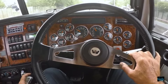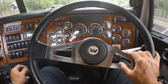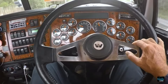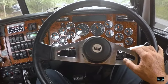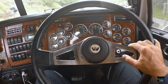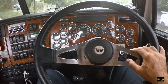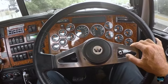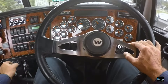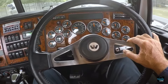We're going down a hill now. I've got a little bit of brake applied, we've got traffic. I'm going to go down a full gear — not a split — so rev and down. Using the clutch is always a good idea when you're not so familiar with a truck. I haven't been in this truck for about six months and every truck is different. So we're losing road speed, losing revs — we're going to get some more revs, give it a little kick in the guts, and there we go. That's downshifting.